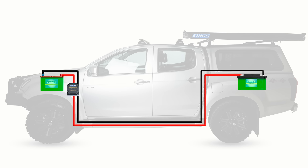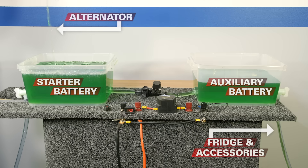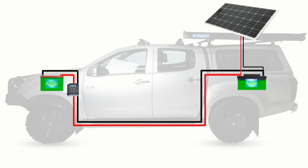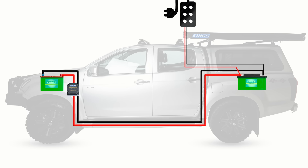You could pull up to camp expecting a full battery when it's already used some of its capacity. Even with a dual battery system that uses a basic or smart isolator and your alternator is putting out a constant 14 volts, if you're using different battery types or have any voltage drop, it's never going to charge 100% properly. You'd need to charge your battery whenever possible with solar, or better yet use an actual 240 volt multi-stage charger with a setting for specific batteries, whether it's flooded or AGM.